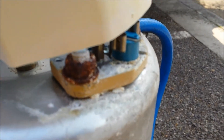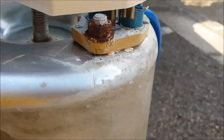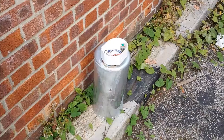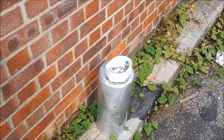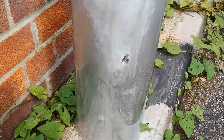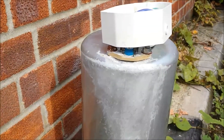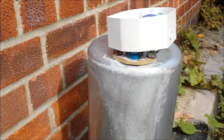So that's the order it goes in — and then the nut on top of there. Now we can already see where the corrosion is: it's from the actual electrical part, the element, not from the tank itself. It's come leaking from the element. So now we know that the tank also — not only corroded there — they've got a hole pierced right through it where the water's dripped down, it's gone rotten from the outside in. We've got that out; we'll take off the element, get a new set of seals and a new tank.